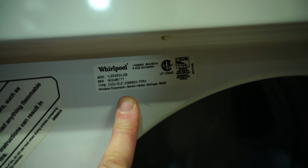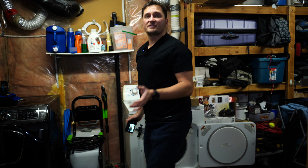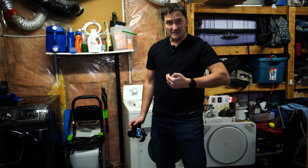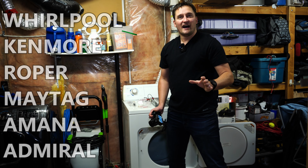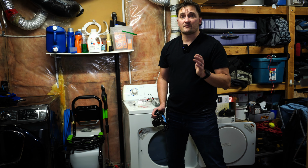Okay, so when it comes to looking for replacement parts, especially on Amazon, that's how I was able to track down that parts kit. I was just able to match up those part numbers. You've got to remember, Whirlpool, Maytag, Amana, a bunch of those brands, these are pretty generic machines and they all use pretty much the same components, but just make sure that your model number shows up on that list because there could be some subtle differences.